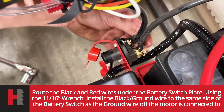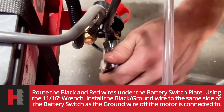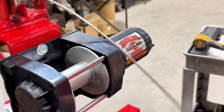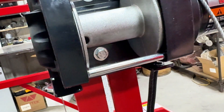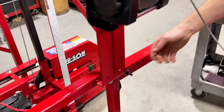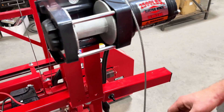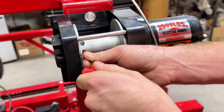These connections come with dielectric grease on them — it wouldn't be a bad idea to wipe it off before you get into all this. Wiring is now all complete. We have our tail end of our cable and our winch. The hole right here is where you're going to put your cable in. Turn your battery switch back on and hit your switch up or down to position the set screw hole straight up and down so you can access the set screw with your Allen key. The set screw most of the time is an eighth inch — if it doesn't fit, use a three millimeter Allen key.